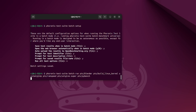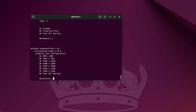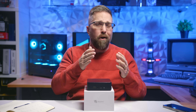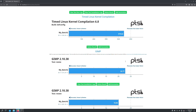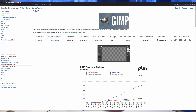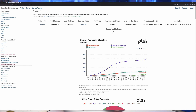The exact lineup of tests will probably evolve over time as I refine my process — I've already tweaked it based on testing this mini PC. On Arch, I set up a batch test run with the following benchmarks: Blender for raw CPU performance, the build Linux kernel test for code compilation, GIMP to evaluate complex productivity tasks, Unigine Superposition for 3D graphics performance, RAM speed to measure memory speed, and Dbench for disk speed.